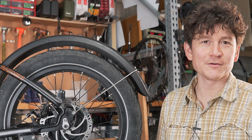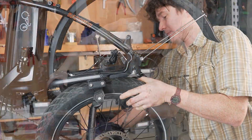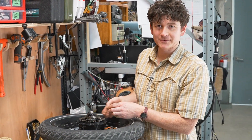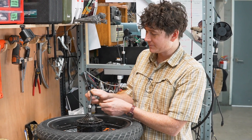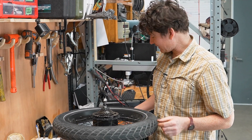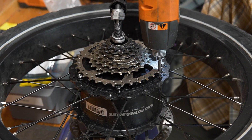First, we're going to remove the wheel from the bike so that we can open up the hub motor and see how accessible the clutch is before we weld it. Normally we'd use a freewheel removal tool to first remove the freewheel from the side plate before disassembling the motor. Unfortunately, this is an unusual motor where the cable exits from the freewheel side of the wheel, so we can't fit the freewheel tool over all of this hardware. But luckily, we can just sneak in here with the Torx driver and undo the side plate screws with the cassette or freewheel gear still in place.